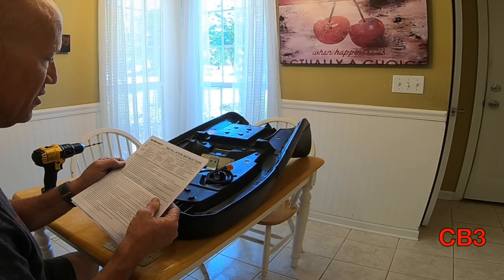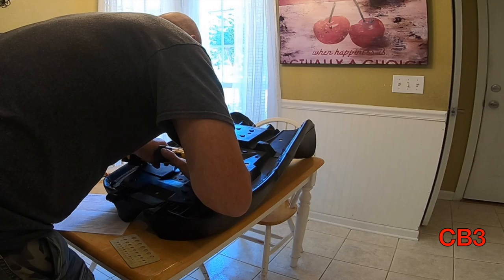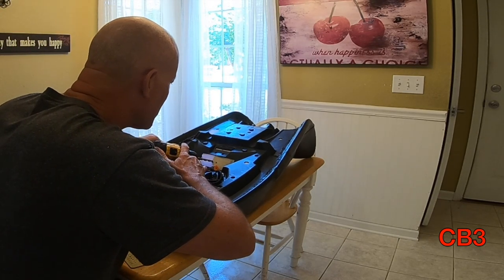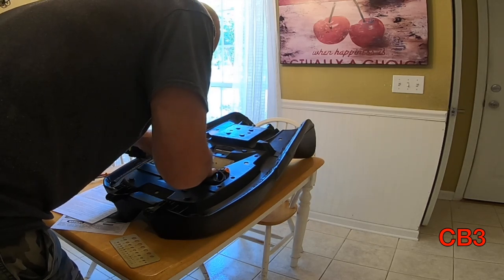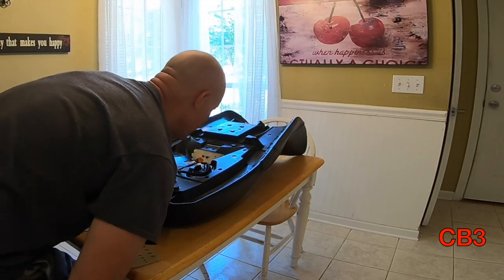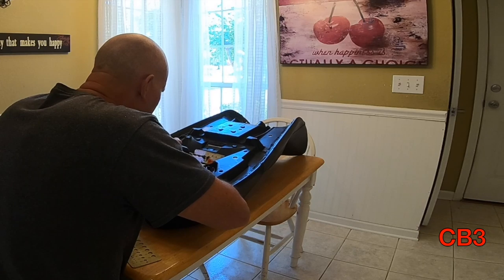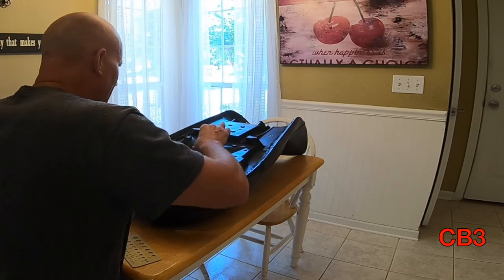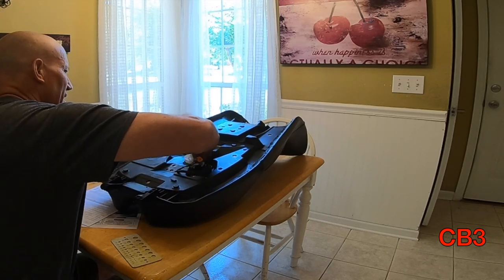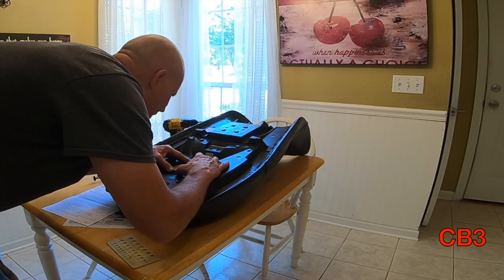I'll take my red marker, stick it in here, kind of go up and down and around — I'm going to take the lead of this pencil as far out as I can all the way around the hole. It says drill a 5/16-inch hole, there's a 5/16-inch hole. I will verify that bit is a 5/16 — before I drill something, I double check. In fact, I'm going to triple check. Remove the bottom mounting bracket, drill holes using a 5/16 bit. I take my time, look and make sure I'm where I want to be. One thing I'd suggest: shove a rag down that hole to keep plastic shavings going down into the seat. We now have two giant holes drilled in our seat.